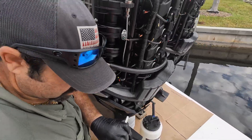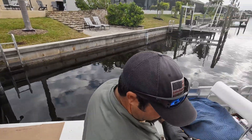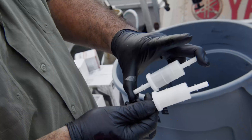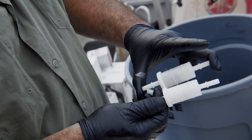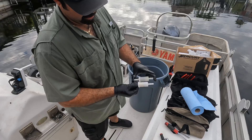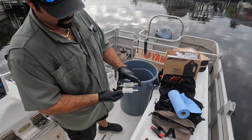Because this is full of fuel, it'll go everywhere. You also want to look at both filters, because I've actually seen oil get backed up into that fuel system — it'll be all black, and when you drain it you'll see oil through it. But this one is perfect; everything's in good condition.